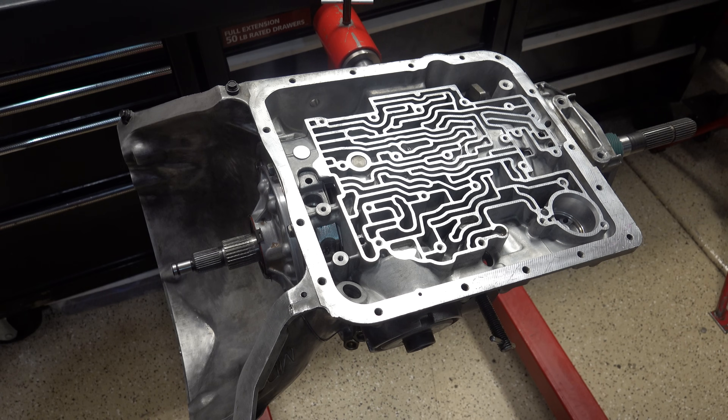In this section I'll talk about why I don't soak my frictions. As folks watch my videos on reassembly and watching me set up all the clutch packs, measuring for clearance and all that, you'll notice that I don't soak any of my frictions in transmission fluid before I install them. I install them dry, I measure my clutch clearances dry, and ultimately the transmission goes out the door largely dry. I do soak my bands, but I don't soak my frictions.